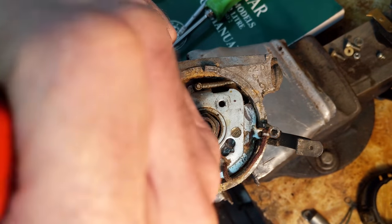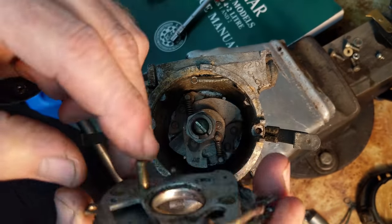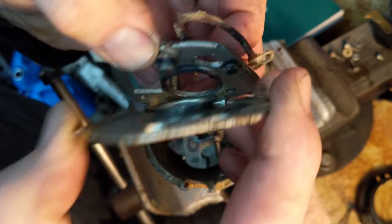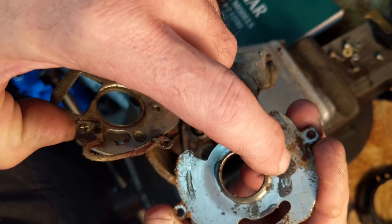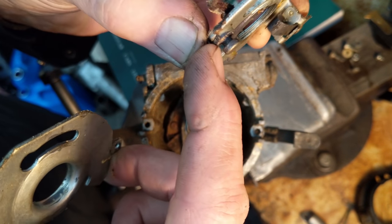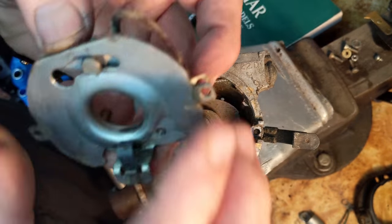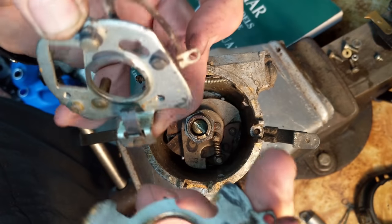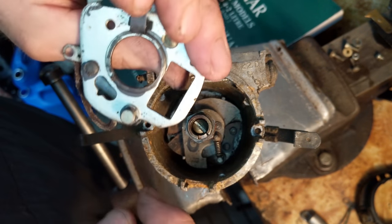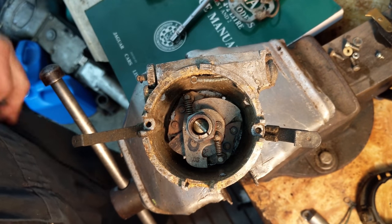Check the resistance — it should have no resistance. So that's the base plate out. The base plate is lubricated from the factory and should be lubricated periodically. It pops apart like that and you can see the contact points here, all around here, with little nylon pads and also this little slot — the slot gets worn sometimes so it's good to lubricate that. I use molly grease on the points where it wears. If you find the slot is worn, you can actually take pliers and just turn it a quarter turn to an unworn spot. I can see a mark in there.